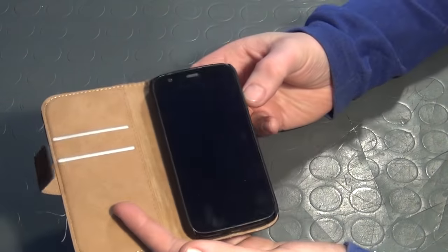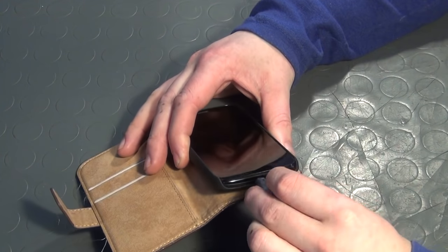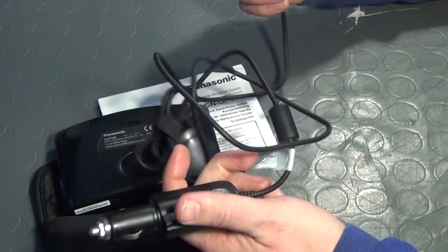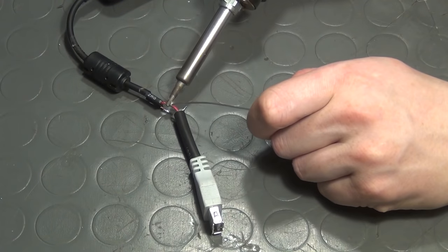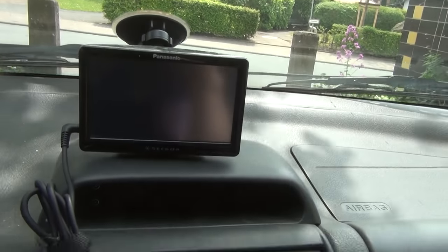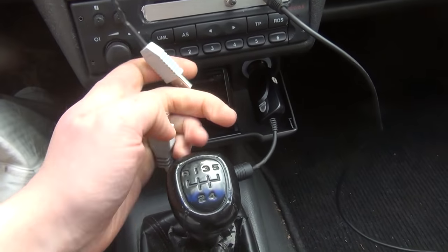But there is one little hack that I still like to do before I call it a day. I recently bought a new phone and I don't have a charger that I can use while I'm driving. But what I have is this 12V to 5V buck converter that is acting as a charger for my navigation system. In order to use it for my phone, I cut this wire in half and insert a USB jack to it. And of course I also add a USB plug to the wire that connects to the navigation system. Now I can use the old charger for both the system and the phone.